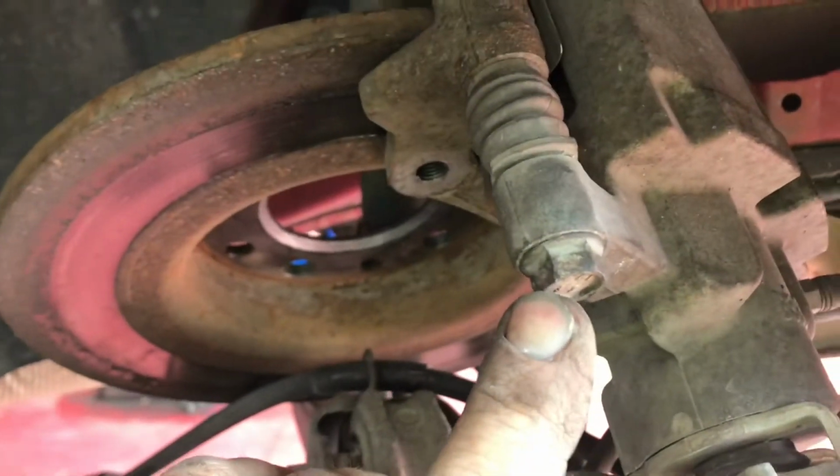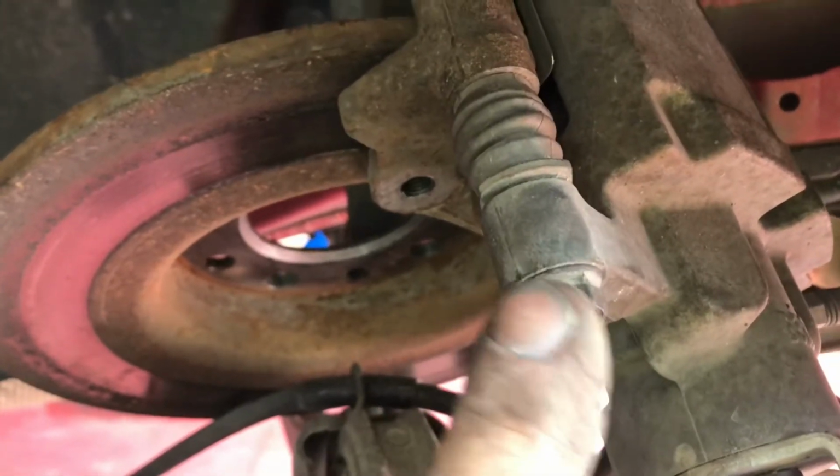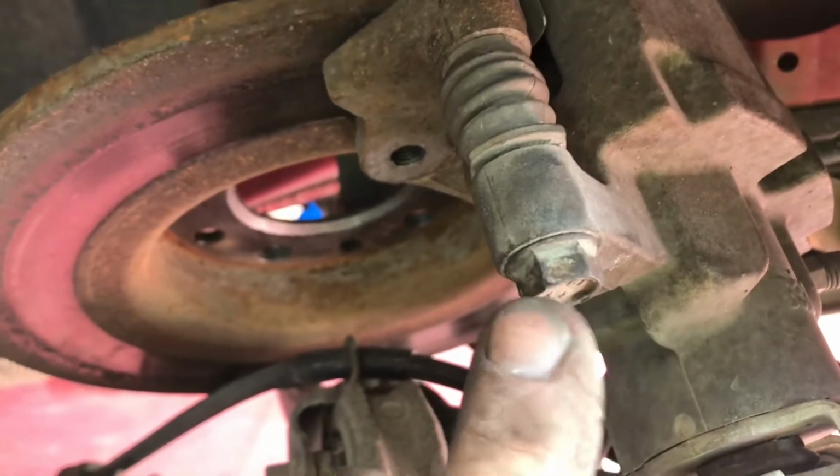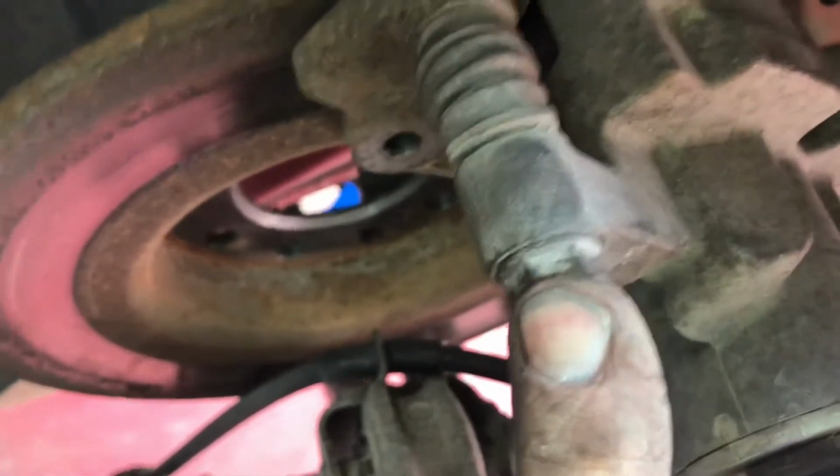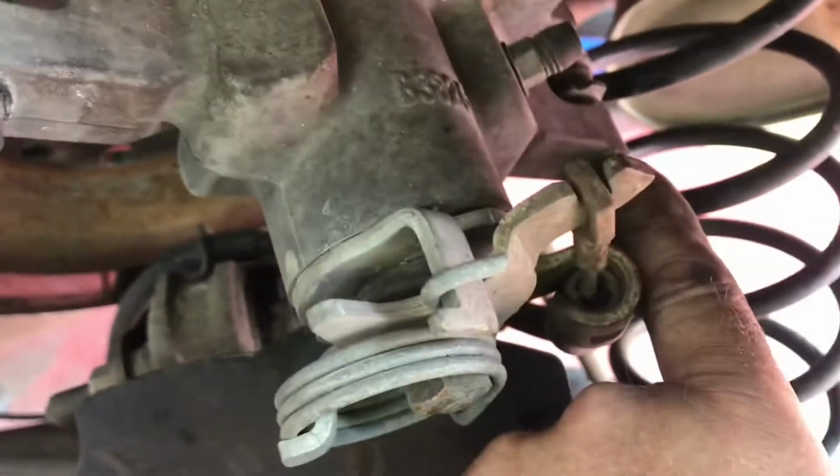Whoops, I gotta apologize. I think I called these 13mm. There's some fucking Dodge Dart purist out there that's just losing his shit right now. Sorry, that's 14mm. And you know what? You don't even really have to take them off. I just realized that. You could leave your caliper bolts in and just take the whole assembly and throw it up here.